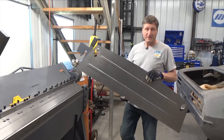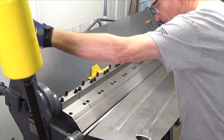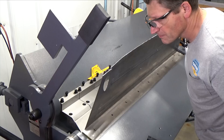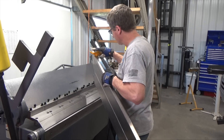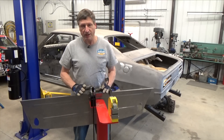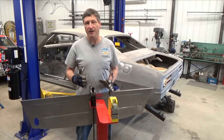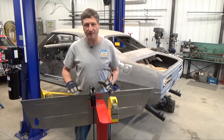Now just put a one-inch, 76-degree bend in it. The main reason for this one-inch lip is so that I can put it in my shrinker and give this panel a contour. The original package tray is perfectly flat from left to right but it does have that contour in it. I want to make sure that I can match that so that the factory package tray trim and treatments will fit this also.